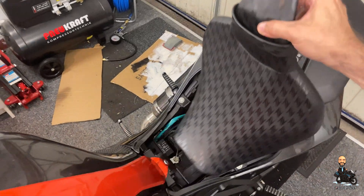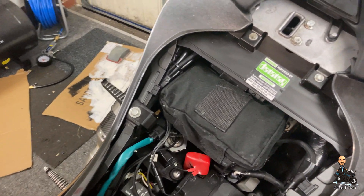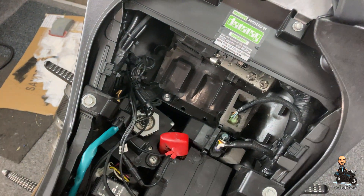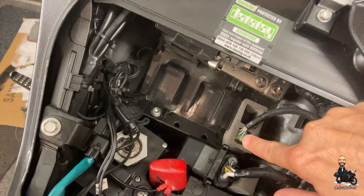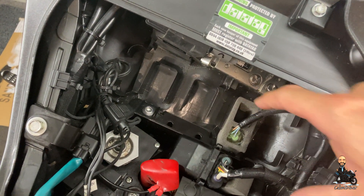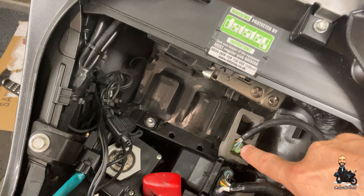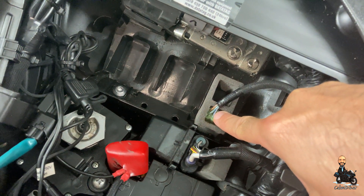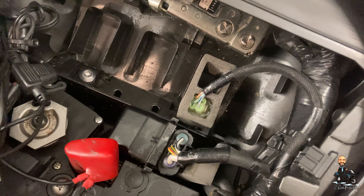Now if you can't get the information you need from that, you need to be under the seat to actually get to the connector. So again, key — I'm just going to pop the seat off. Under here I've got a puncture repair kit, but aside from that, you'll see you've got these three rectangular areas that could take cables, only one of them in use. Not this foam rectangle with two holes in — only one hole in use. But this connector here, according to the service manual, not the Haynes manual, is the immobiliser and the Kawasaki diagnostic connector. So it's a two-in-one thing — unless you haven't got an immobiliser, in which case it's just the diagnostic connector.